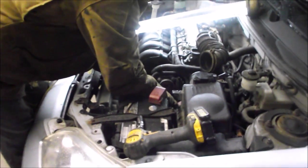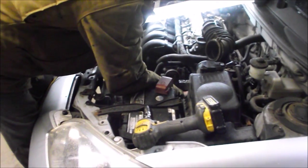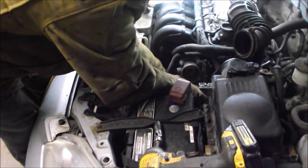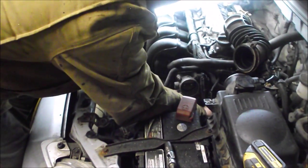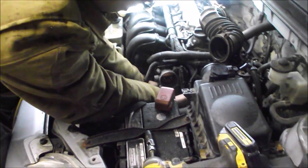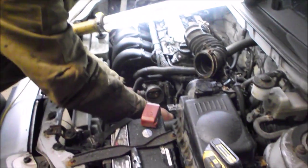So here we are — we tried to back the car out of the garage and realized the brake pedal is really stiff. No power-assisted brakes, and that's obviously a problem. We thought maybe low vacuum is causing the brakes not to work with power assist, and that could certainly explain why the idle is really rough too.